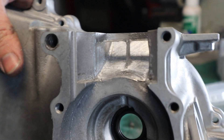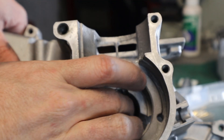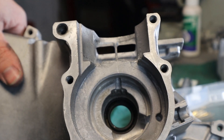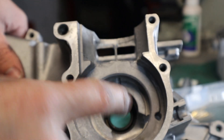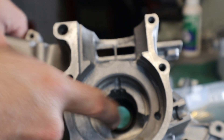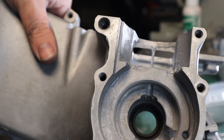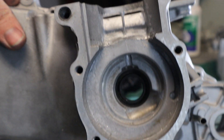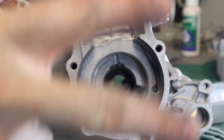With all that done, that's most of the porting done. I'm going to be making the plug that goes in there and JB welding it — I'll do that off camera but I will show you the measurements so you can make your own. Basically it's just an aluminum tube that gets pressed in to the seal surface so I can fill this whole area up with epoxy or JB Weld. That's it for me for tonight — until next time, take care.